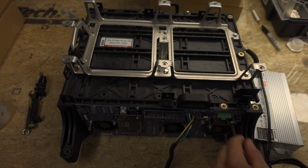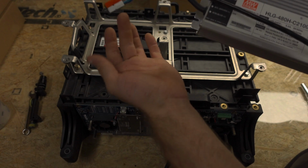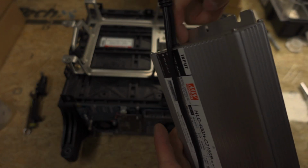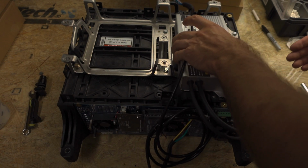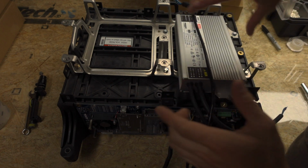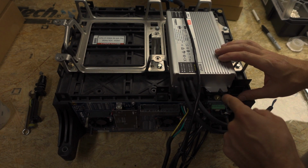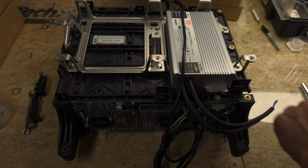These are plastic inserts. So next we're going to take your grid charger, and you've got the side with these Anderson plugs on it. That side's going to go that way. And we're going to take this lip and stick it underneath here. So I'm going to do that now. And now you want to push this as far as you can to the left. To move it to the left, you'll need to actually pick it up slightly. The goal is that you line the notch here up with this hole right there. And you can see that we're going to screw a bolt in there.